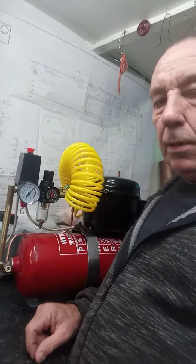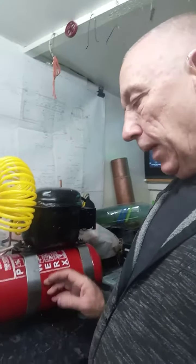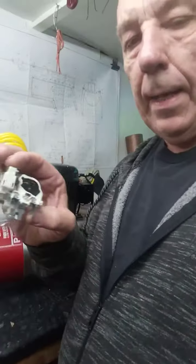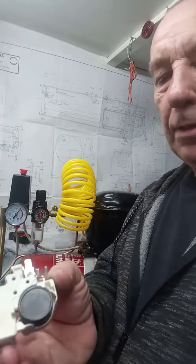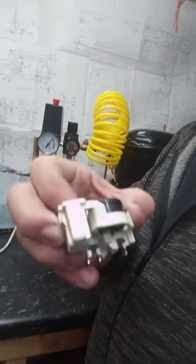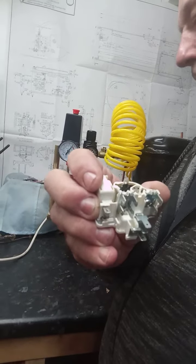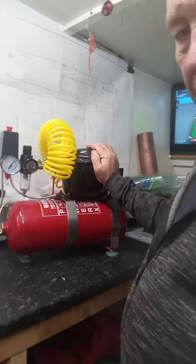There it is — it's just clicked off and the pump stopped. If you find a compressor that doesn't start or starts intermittently, you'll find one of these components on the side of the compressor. There are two parts inside: a thermal cutout and a start relay — a PTC thermistor — that starts the motor running in the right direction. They're only cheap, about 8 quid brand new, so that gets an old compressor up and running again.